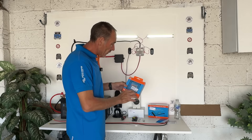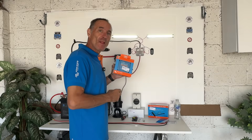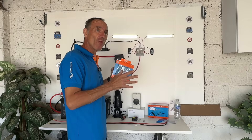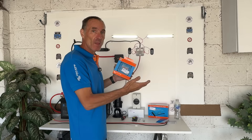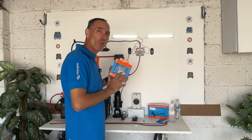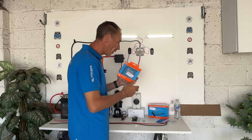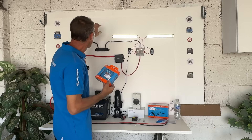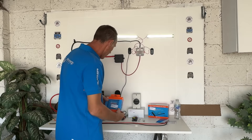Anyway, 75 volts times 10 amps — this would be completely fine for a 145 watt solar panel. Any more than that and you'll have to go the next size up, which would be a 15 amp, 20 amp, and so forth. You need to size these for the solar panel you have purchased or are going to purchase. For demonstration purposes, we are going to mount this here, and then we're going to have a breaker. Now there are two types of breaker.